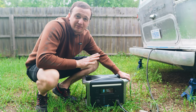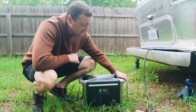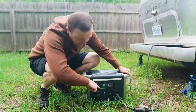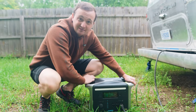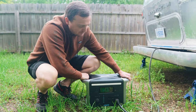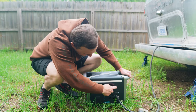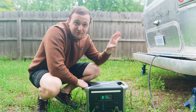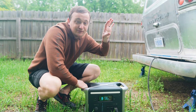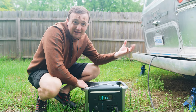We just turned the camper on and all we have running right now is the fridge and the power inverter for the DC lights, and it's drawing about 109 watts of power — which is really not much at all. Remember, this can draw up to 1500 watts at a time. So running at its current state it will last approximately 8.4 hours, which is pretty much all day with the refrigerator running. Keep in mind, once the refrigerator reaches temperature it turns off, so you can basically run everything you need all day.